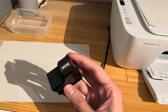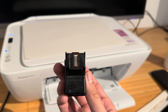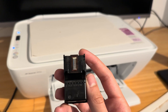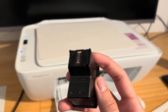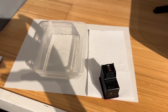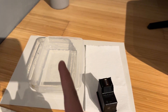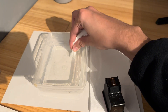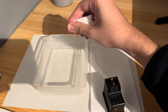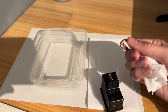If it's not doing that, it could mean you haven't used your printer for a while and the print head has clogged up or is slightly dry. So we'll move on to our next solution which involves getting some tissues and some warm water. I have my ink cartridge here, a little bit of tissue, and some warm water — it needs to be warm water, that's very important. I'm going to dip just the tip in and give it a careful wipe down, and you can see some ink is coming off.